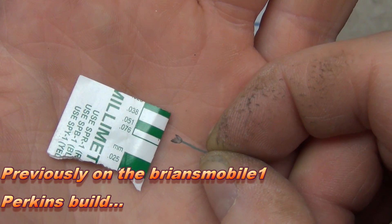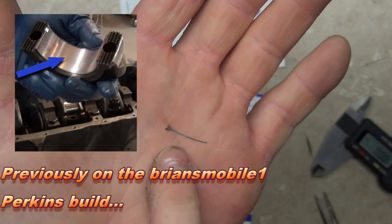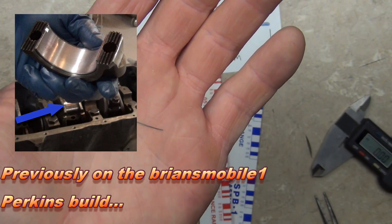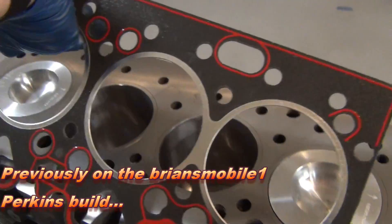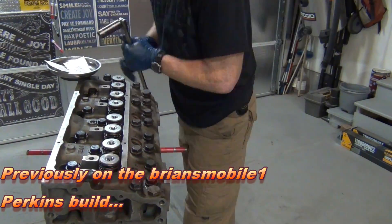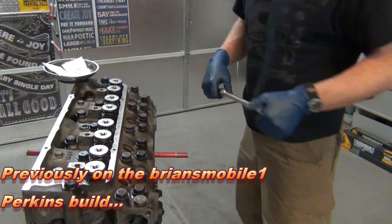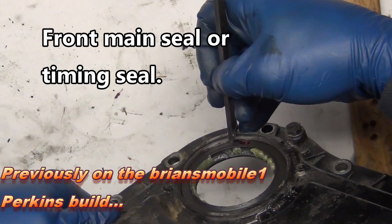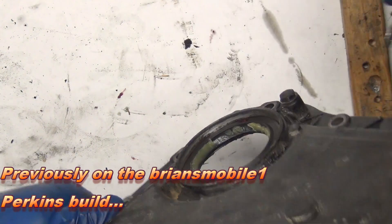You're able to get these amazing readings by crushing the plastic in between the bearings and the crankshaft. Did you identify where that oval is? This part's all on — this is a little high, a little low. This needs to go some more.